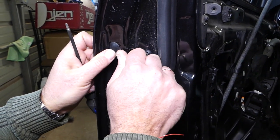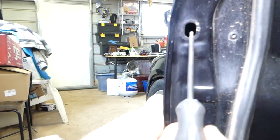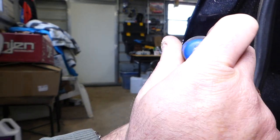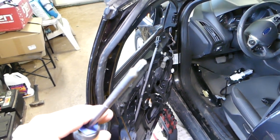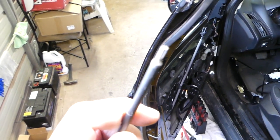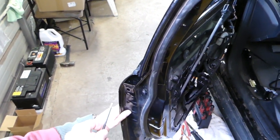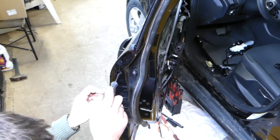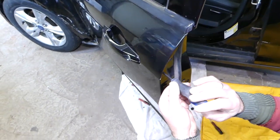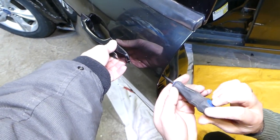There's a cap here we need to go ahead and remove. Right here on the inside there is one bolt — and this is a Torx. All the tools and parts we use will be listed in the description of the video below. The light is a bit weird because it's a little dark at the shop. We'll go ahead and get it loose — start getting it loose like that, and eventually you're going to feel your door lock coming loose.